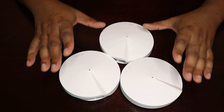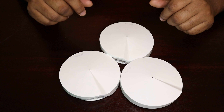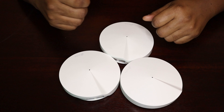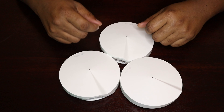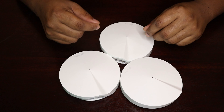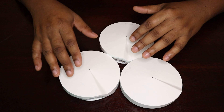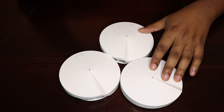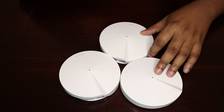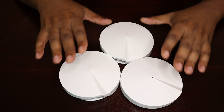The advantage of having a mesh system is that it is just one seamless Wi-Fi system — one SSID name. That means you don't have to physically join different networks as you move around your house, unlike with extenders where each extender carries a different SSID name and you'd have to manually log into each one. Also, each extender reduces speed by 50%, so the speed from an extender is half the speed of your router. With a mesh network, your speed remains the same all around the house.